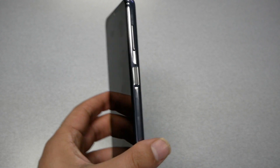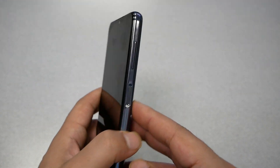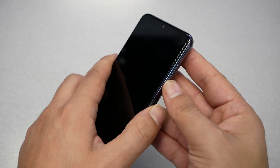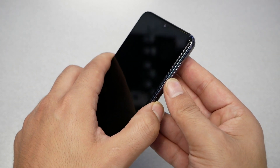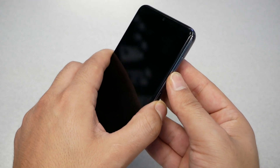So you don't want to damage your phone. Here's what you need to do if you have a blank or black screen: all you have to do is press the Volume Down and the Power key together for around 7 to 10 seconds.